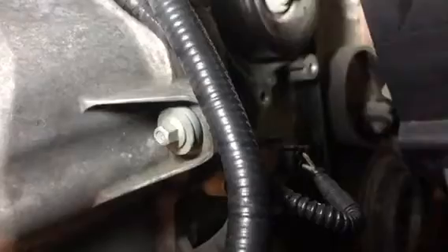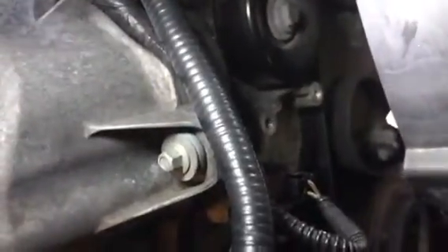There are the three bolts that I will clean up before I put back in, and that is the new one. As you can see the belt stayed right in place, so you might actually be able to keep the belt on and just slide that pulley right on the belt as you hook it up. Now I'm going to get a little bit of MPL and clean up some of those bolts with just a red rag and a little bit of MPL.